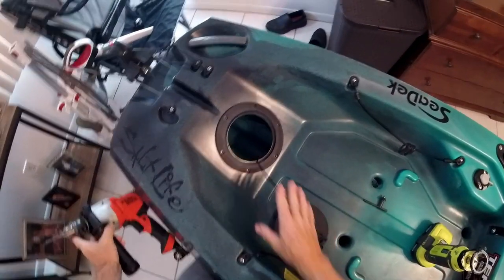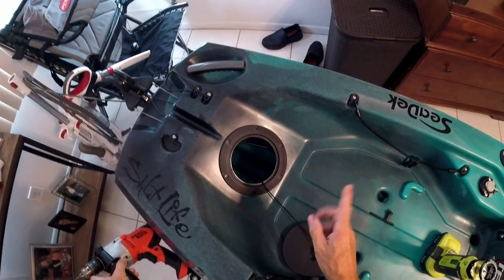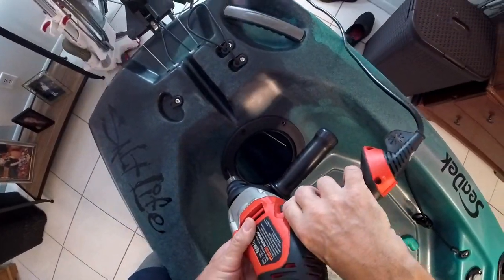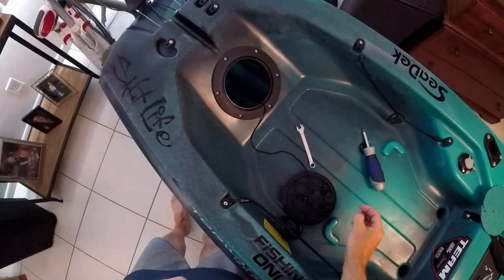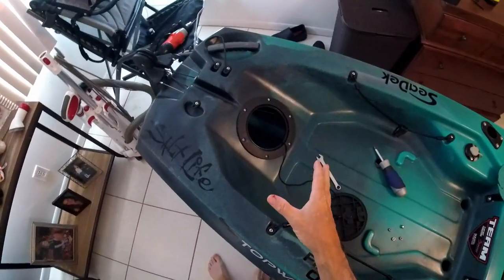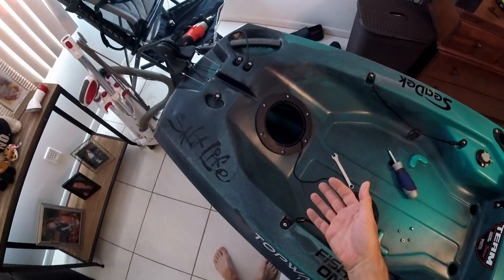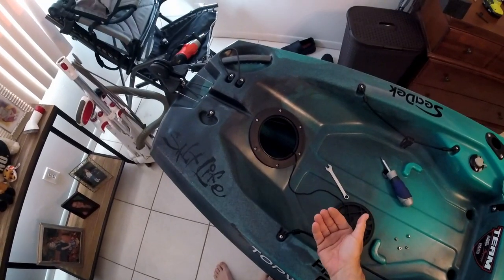Now that I've got my hatch in, I'm happy with the placement of the outer portion — it's nice and snug. I'm going to go ahead and pre-drill my screw holes. One important thing to keep in mind: before you put the hatch down and insert your screws, make sure you've replaced the rubber gasket that goes on the bottom of the hatch — this will help keep water out of the hole you've made. You can also add some goop or other watertight sealants if you like, but please make sure you've reattached the rubber gasket to the bottom portion of the hatch frame.